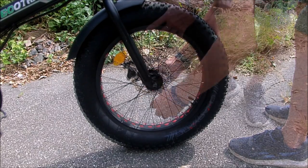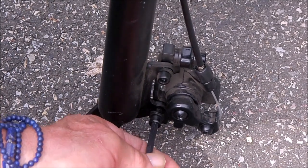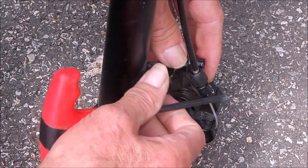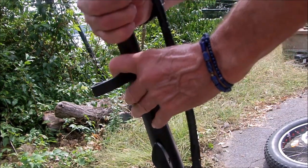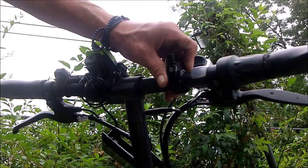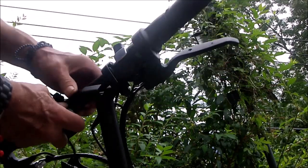Next, you want to take off the front tire. The standard forks are wide and provide a pretty stable base, so you don't need a helper to hold it up. The next step is to take off the front disc brake caliper. I pushed the steering column all the way up, hoping to get the handlebars far enough out of the way, but then decided to take the handlebars off the steering column entirely. I had to remove the S900 LCD before I could work the clamp that releases the handlebars. Once I got the handlebars off, they were well out of the way and nothing else needed to be removed.